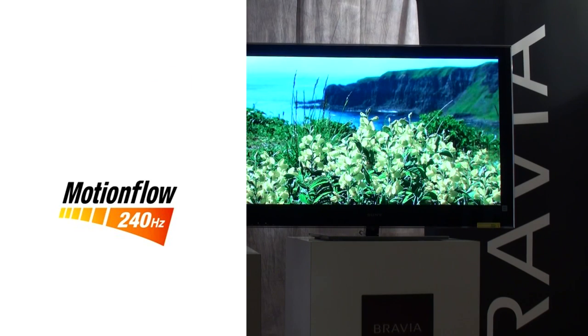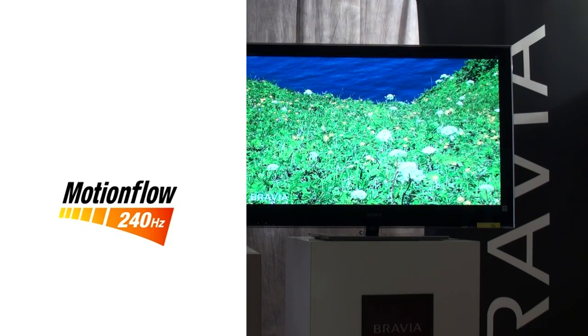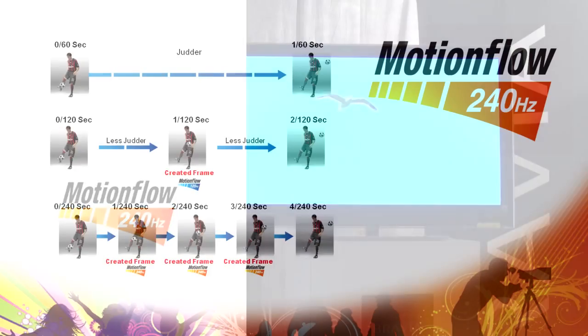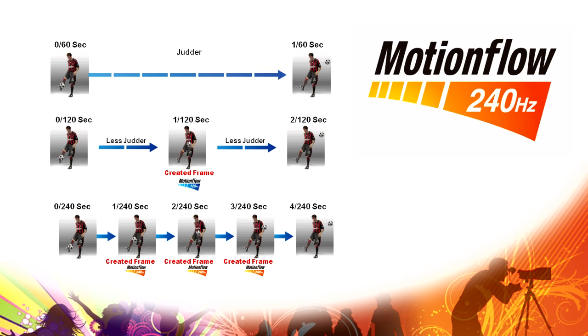The other great image quality technology we have is Motionflow 240. And what's great about that technology is it actually creates more content than comes into the TV. Let me explain. A regular TV picture, you have an image about every 60th of a second. With previous incarnations, we add 1 extra frame to give us 120 frames a second. With Motionflow 240, we actually add 3 brand new complete frames in between each original frame to give you smooth, beautiful motion.